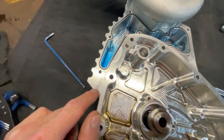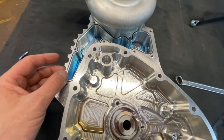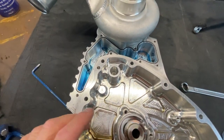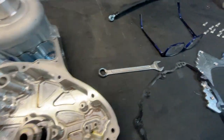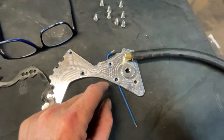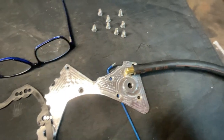I took the back of the oil tank off because there were drips of blue fluid down here, but it all seemed okay - it wasn't leaking from this seal. I am going to put a little bit of seal around it just to make sure. But the main culprit was this banjo connection on here. I can't really see much wrong with it so I've polished this up and I'm just going to do it up a bit tighter.